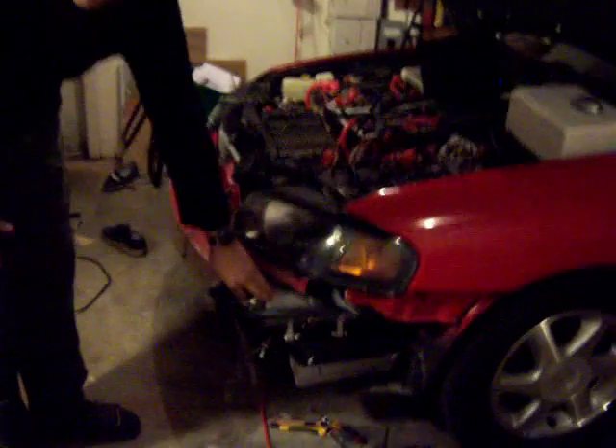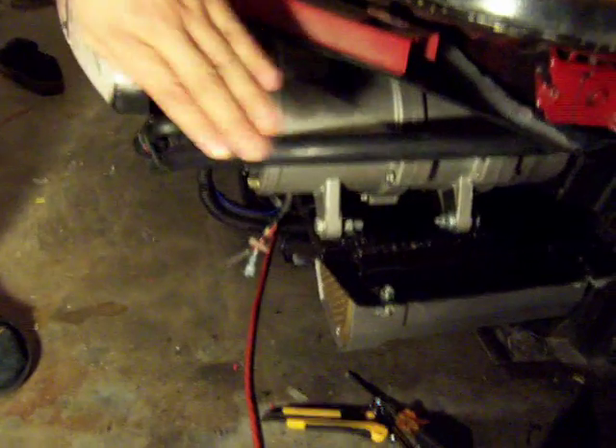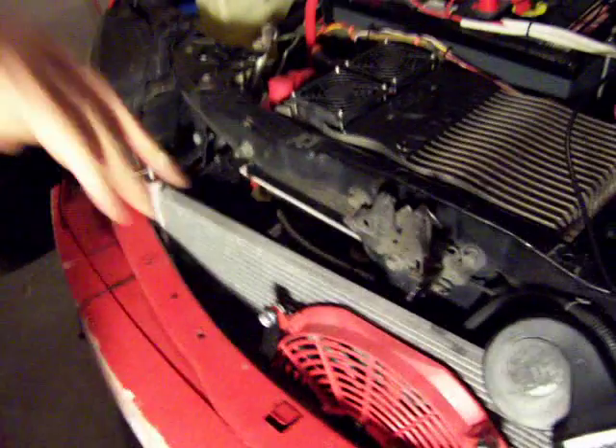What I'm currently working on is the air conditioning. This is what I was having trouble with in the last video. I've had the hoses installed, the pump installed, the controller installed, the condenser, and the fan — and it's working really great. The problem I was having was that it was blowing fuses when accelerating due to something called ripple current. What these controllers need — because they don't include one — is an inductor and a rectifier diode, which I've installed here.